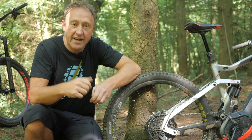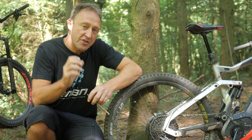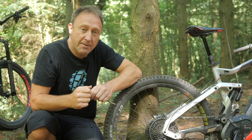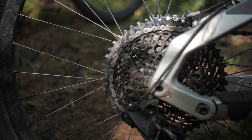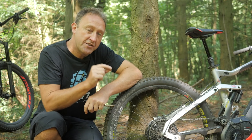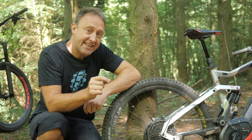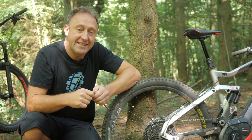You can actually do it quite inexpensively. What's interesting is that this year particularly, lots of brands have changed from a 16-tooth front sprocket — there's actually a 16-tooth on this bike — down to a 15-tooth up front. With the addition of NX Eagle, people are now running a 10-50 cassette at the back. What you need to remember is that if you change one tooth up front, it's equivalent to about two or three teeth at the back. Today we're going to be swapping between a 16, 15, and 14 tooth front sprocket to see the effect it has on the ability to climb.